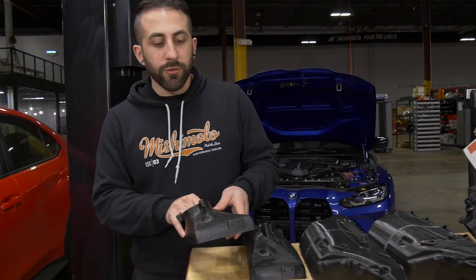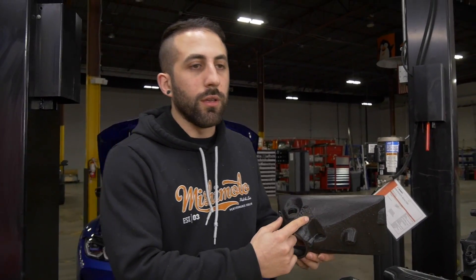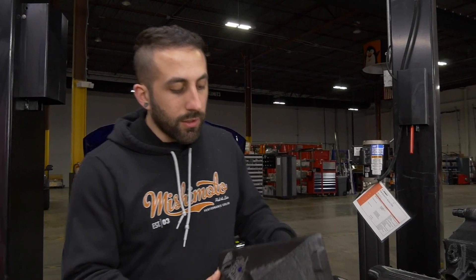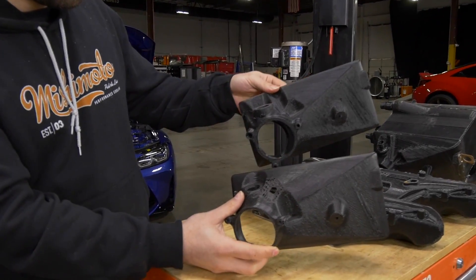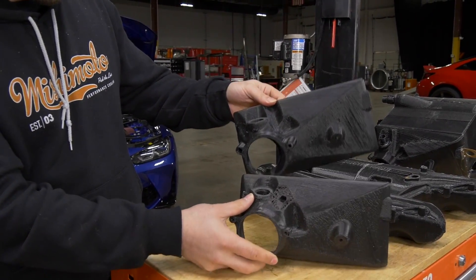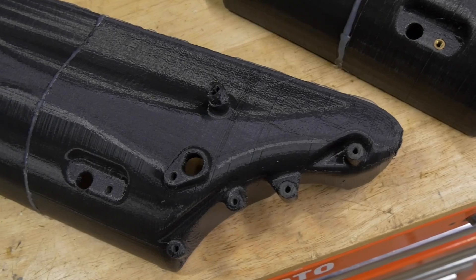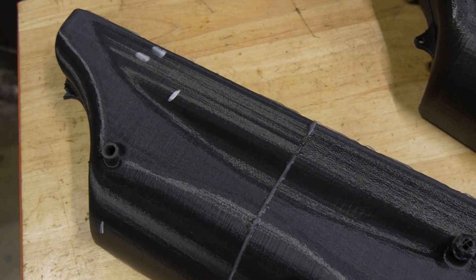This is the first iteration of the bottom plenum. These are where the coolant ports on the throttle body kind of come through right there — it was a very hard geometry to get. You can even see when you go from iteration one to iteration two, you have a few changes, and we added a fin inside of here. You can see something similar with the upper plenum and runners — there are a bunch of different runner shapes that we tried out.